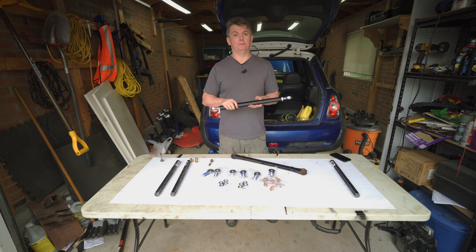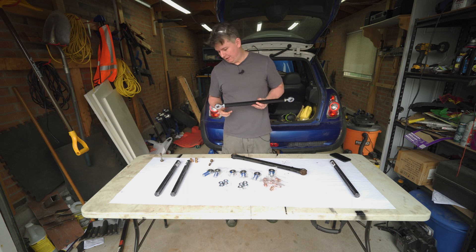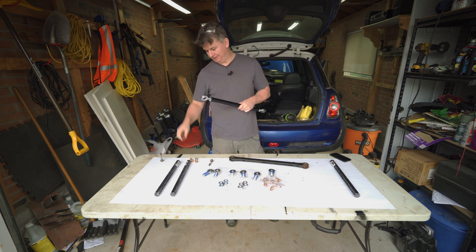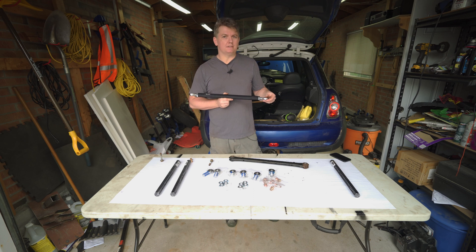You can add camber to your rear and get better traction on the track — and on the road too, but I wouldn't recommend this style for road use. If you look at the soft rubber bushings in the factory one compared to what we're doing — basically replacing it with steel on steel, especially with the spacers — a lot of you might say it'll rattle your teeth out. But this car isn't designed to be comfy on the road; it's going to be a track-focused car, so I'm going for the stiffest possible suspension.